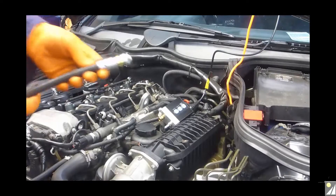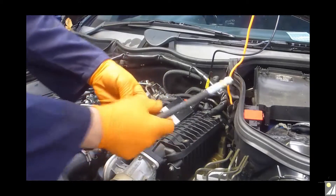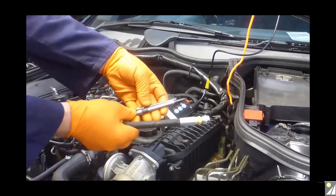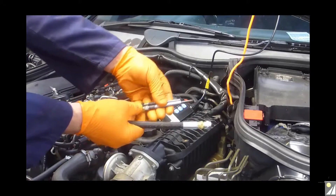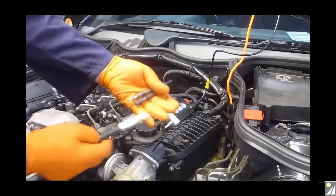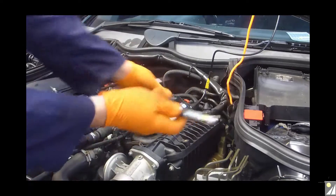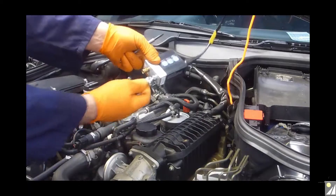So what we have is the AST conversion hose, and the AST compression dummy glow plug adapter that matches the vehicle glow plug. We also have the adapter that connects and a conversion so that we can connect to the WPS pressure transducer.